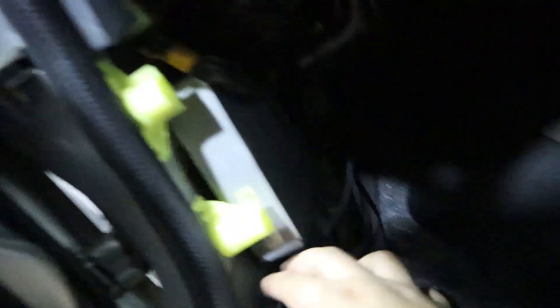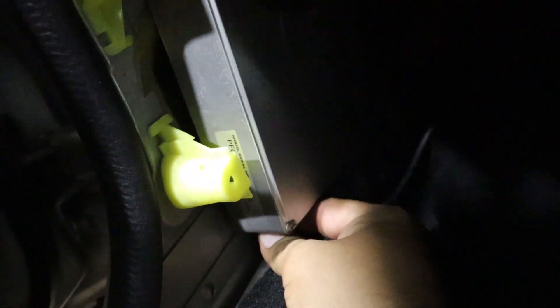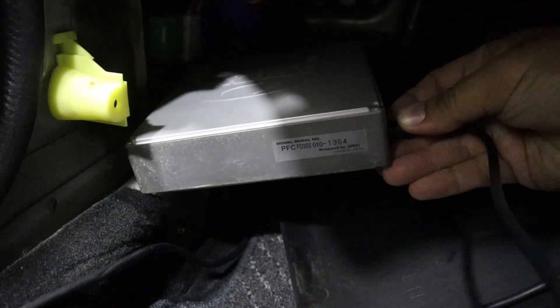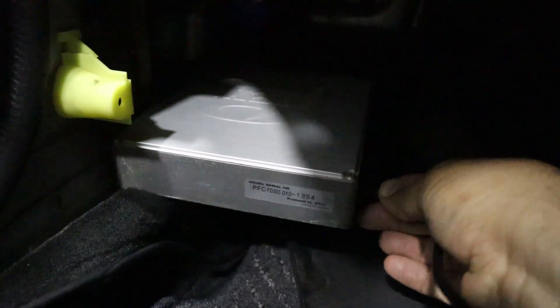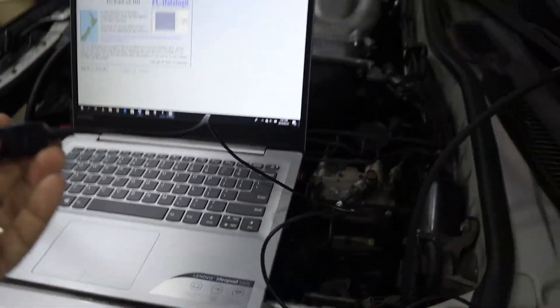Now that the kick panel is out, I'm going to find out where my hand controller is plugged in, which is this guy right over here. As you can see, I've just fed the little cable down somewhere under there and it ends up at the bottom of the ECU. So I'm going to unplug that and carefully plug in the cable of the FC Hacker. Nice — lucky for me the cable is quite long.